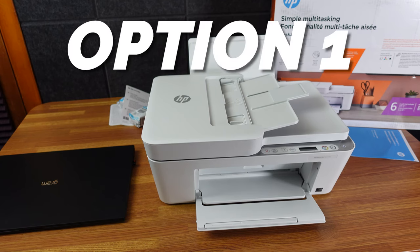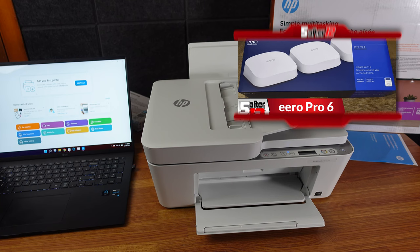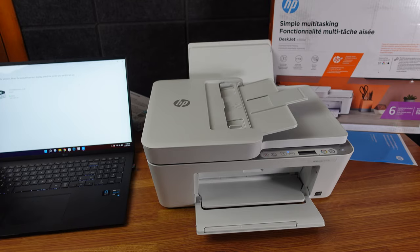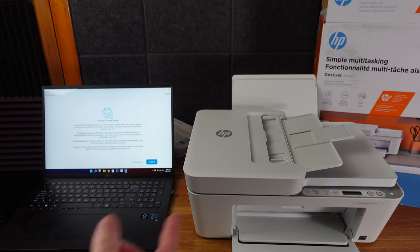So I turned to Reddit and to Amazon. There are two options we're going to try. One, I'm going to get it into Wi-Fi pairing mode and then hit the WPS button on the back of my Eero router. So it's flashing — it means it's looking for Wi-Fi. I pressed the little WPS button on the back of my router. So I solved the mystery — well, Reddit did. I have the Eero router and I had WPA3 security turned on, and these Wi-Fi printers apparently don't work with that. As soon as I turned WPA3 off, it connected itself automatically — before I could even turn it on, it was automatically found from my app. If you have WPA3 turned on your router, you got to turn it off for this printer to connect.